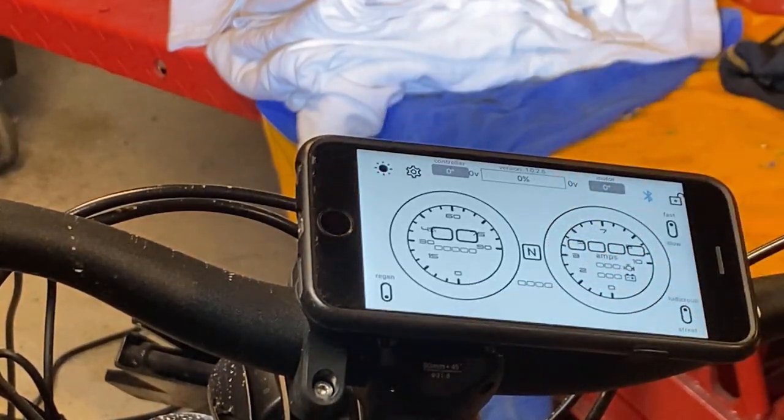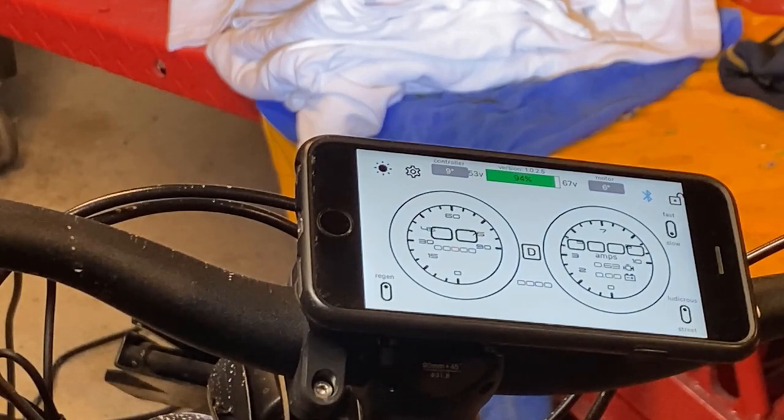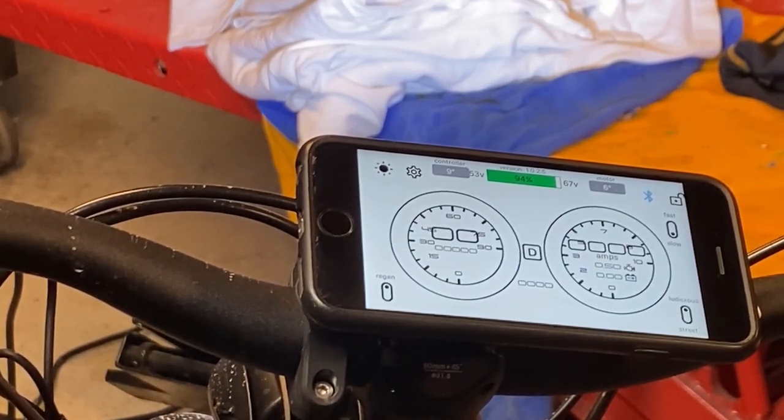And then when you go back on your front end screen now, you should have this additional button that shows you slow and fast. Now, what's the difference between slow and fast and ludicrous and street? I look at it this way. Ludicrous and street is simply the maximum power output. So 7,000 or 5,000, everything else is the same. Fast and slow just modifies your top end speed limit.